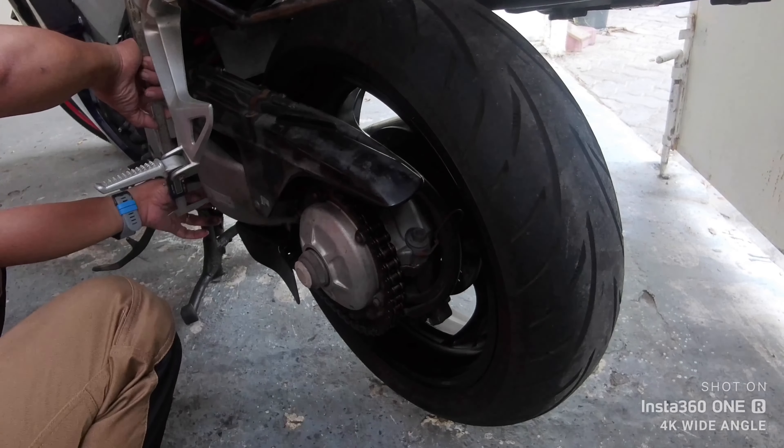If you want to be thorough about it, go to the tight spot and measure 25 millimeters — push it down and up — exactly 25. Very nice. And I think we're done. That's how easy it is to adjust your chain.